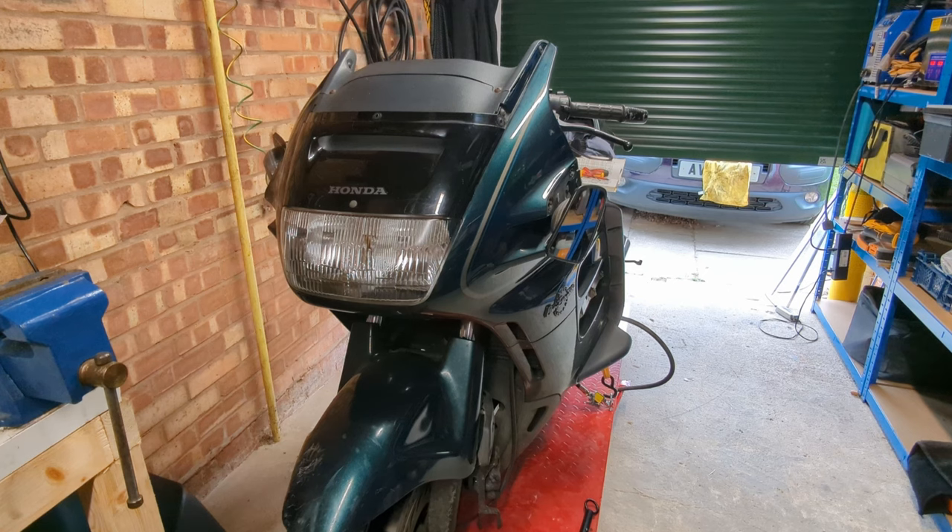What we know about it so far: a friend had to take the brakes off because it doesn't roll, so the calipers are going to need refurbishing. There's a whole bunch of bodywork missing. There's an angle grinder cut or a split in the rear rack subframe, so that's going to need sorting out. And just generally the whole thing looks like it's been stored underwater. I feel like it's a seaside bike because there's rust on all the joins in the frame — not severe, not structural, but that will need treating and painting over. The last time this thing had an MOT was 2013, so it hasn't run probably in 11 years. It had a water leak, for which the radiator was replaced and stop-leak was thrown in, which probably means it's a classic Pan-European problem with the water pump. Since the cam belt's been sat still for probably 10 years, we're probably going to have to take that apart, replace the cam belt, and give the engine a full once-over to figure out if there's anything wrong with it.